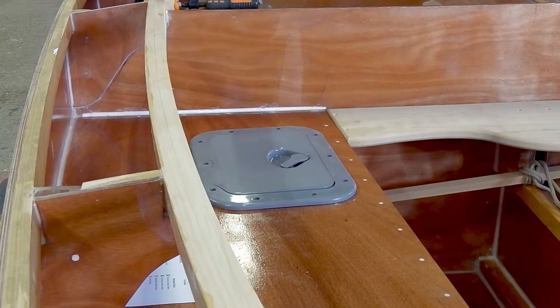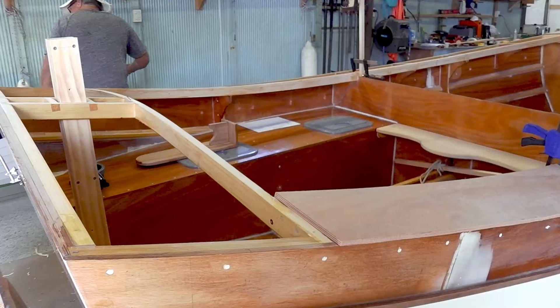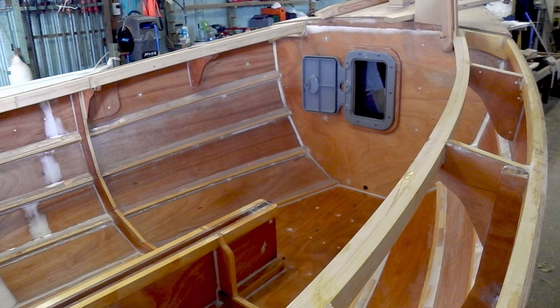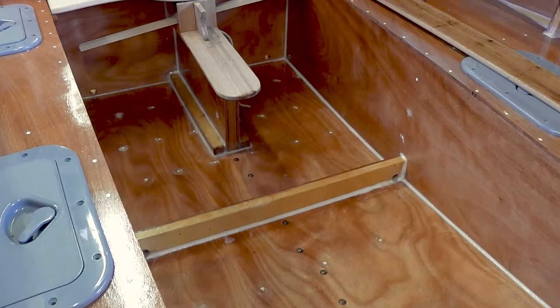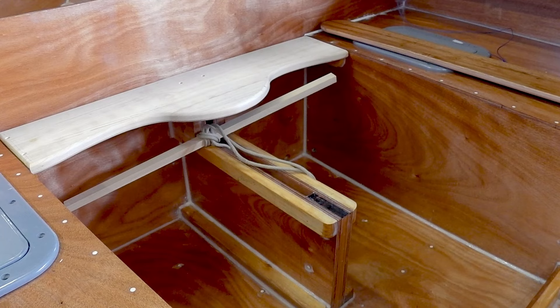Remember, nothing's really square in a boat — it's all curves. The Ptarmigan is built out of 19 sheets of ply. It's double-hulled all the way through: 9mm ply and then another sheet of 9mm ply over the whole bottom, so it's 18mm thick. And then fibreglass with 400gsm double bias — which wasn't in the plans, but a little bit of extra strength never hurts. That's substantial.